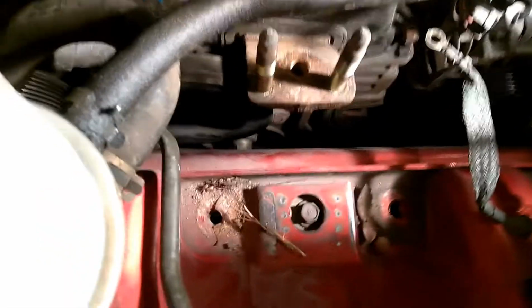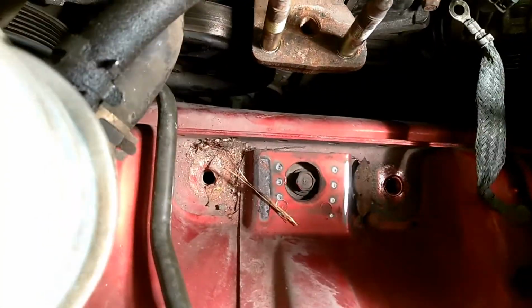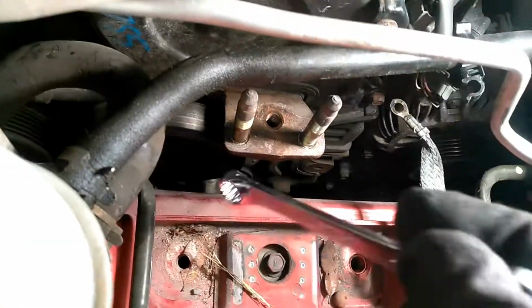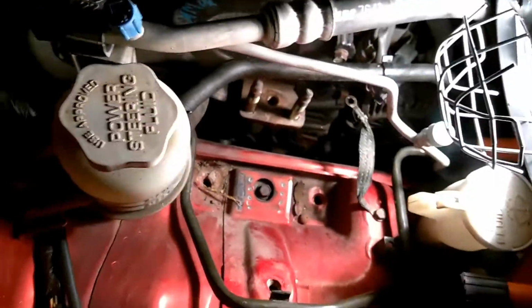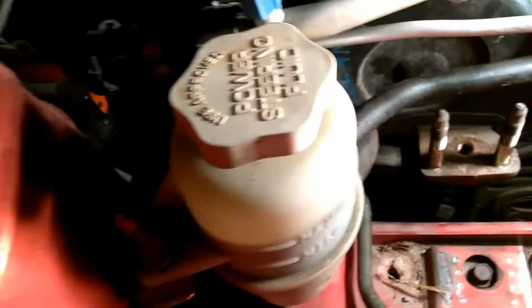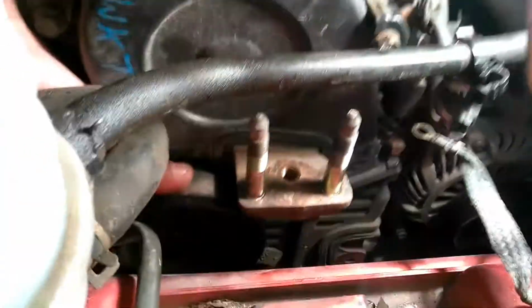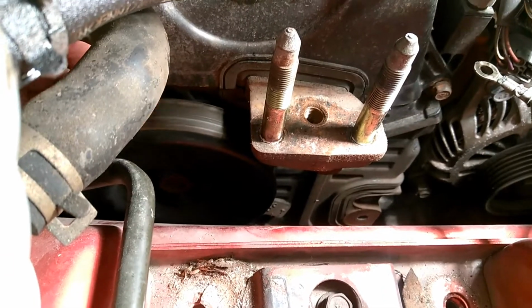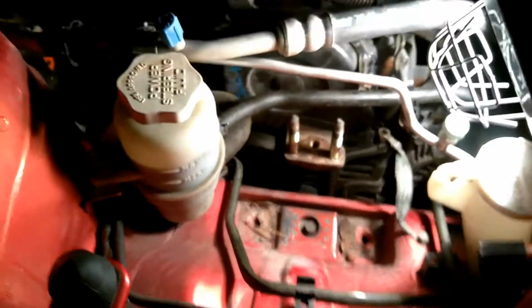As you can see, there's not a lot of room going in there. Also understand that when you get your wrench on there, this thing is freewheeling, so it's going to turn with you. They're not really tight, but the easiest way to do it is take one hand over here, wrap it around, and grab it, and then use your other hand to take the 4 little bolts off. So let's go ahead and get that off of there.